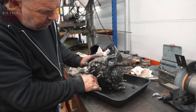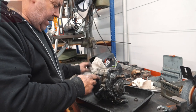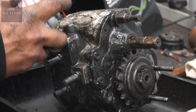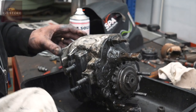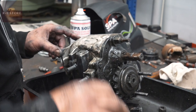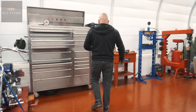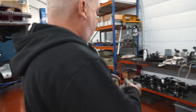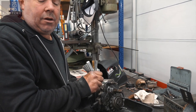Those should be tight in the bottom of there because they go straight into the gearbox casing — so I shouldn't think that's got any oil in it at all, it's all pissed out the bottom. That's obviously weld. Well that's all welded. Chances of that holding oil? Pretty slim. The trouble with them is they hold oil for so long, then the oil gets ingress into the aluminium — it doesn't matter how much you try, you won't ever weld them properly.